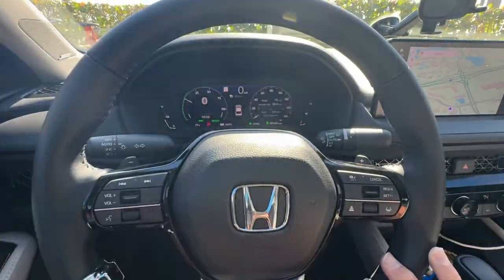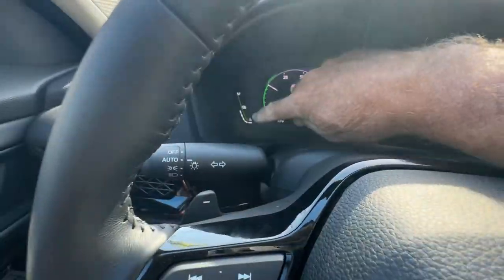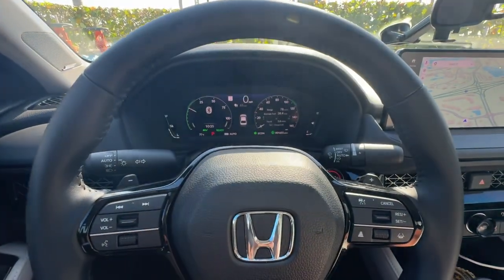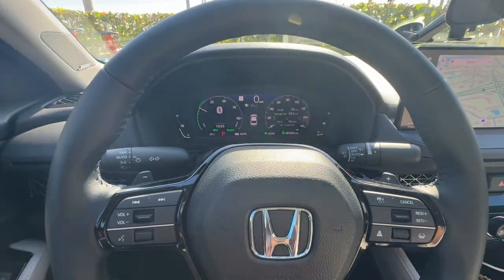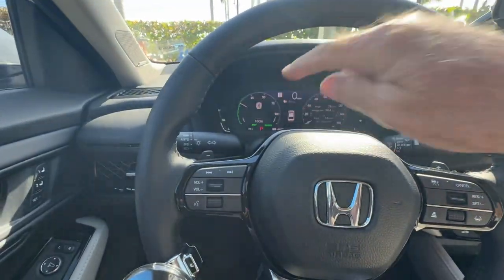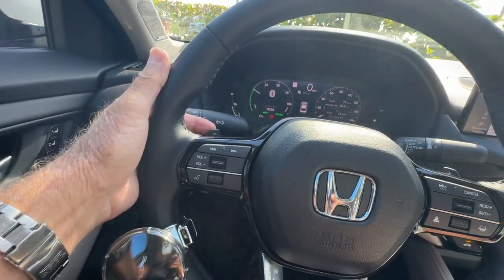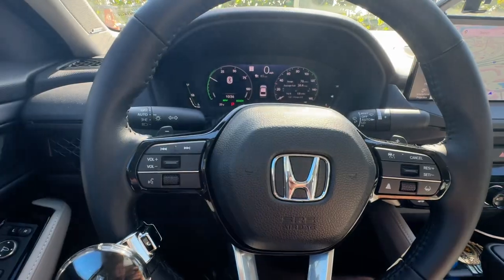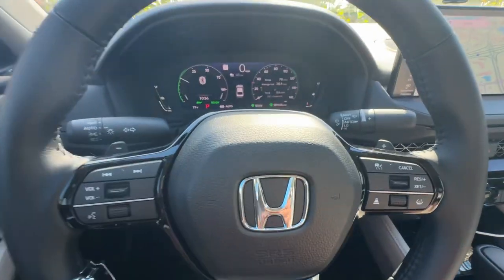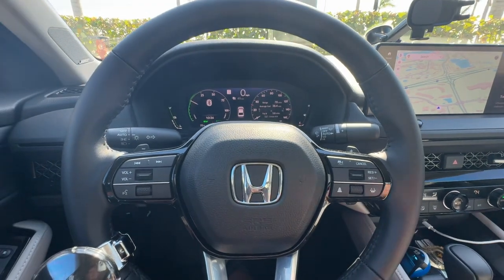So that's a little tip for you. Regenerative braking is good to have when you let off the gas pedal — it keeps your EV mode lithium battery charged on these hybrid cars. So when you're driving at low speed in the city, you have a battery fully charged to push the car. Just hold that button for about two seconds, and now when you let off the pedal and press it again, the next time you let off it will remember it's still on. And to turn it off, hold the other one and you're good to go. I hope that helps you out on regenerative braking.